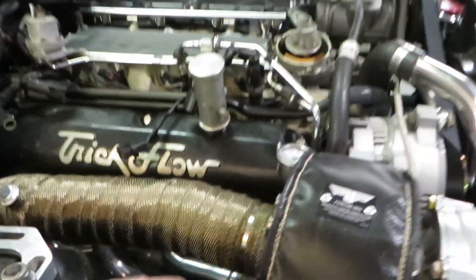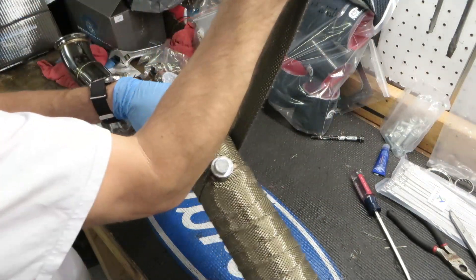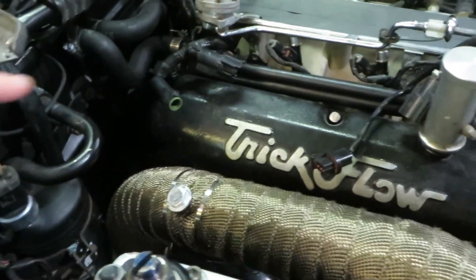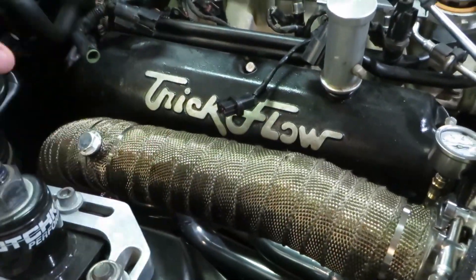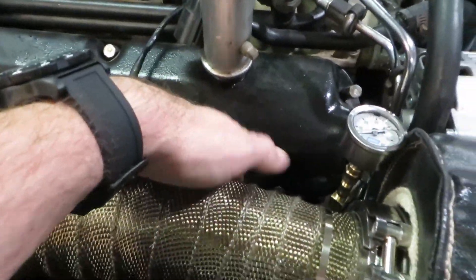Fast forward a couple of days — life is busy and I'm taking my time doing things methodically. I've got some more work done. I've got a PTP lava wrap on the down pipe and went ahead and put the turbo blanket on. I wrapped the down pipe with a two-inch PTP lava wrap — this is the non-fiberglass kind with a stone-woven edge. Make sure that woven edge is the exposed edge; there's a right and wrong way to put this on or it will fray. One roll just about covers down to the floorboard, though it doesn't cover the full length of the down pipe. The main thing is keeping heat away from the engine compartment. The spark plug wires going through here will be wrapped as well. I'll still need a custom AC line rerouted.